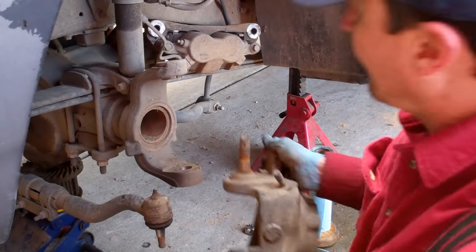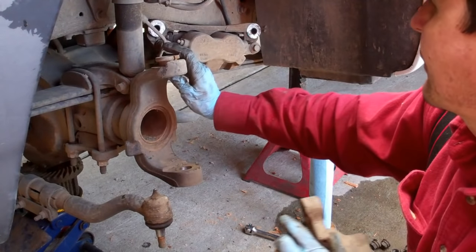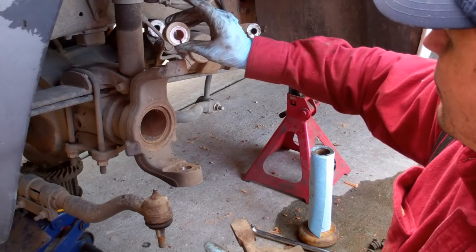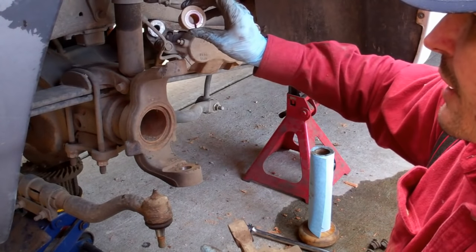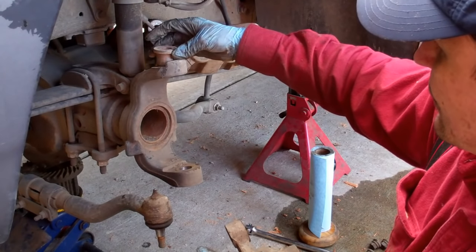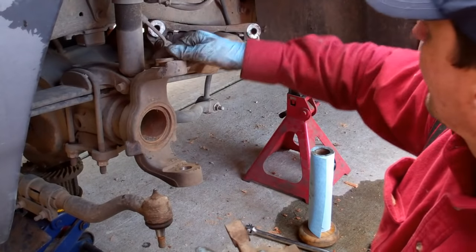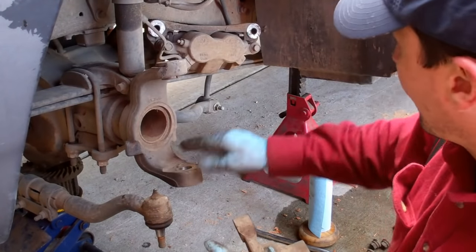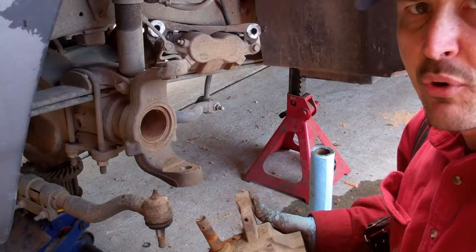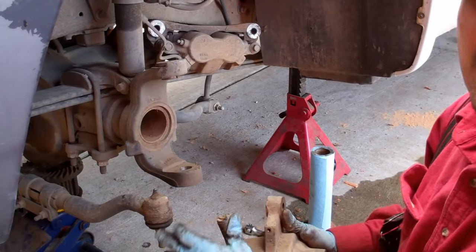All right, there is a little adjuster caster nut, or I don't know what you call it. Mechanics, you guys can put in the description what it is, but it will help with the alignment. We'll have to have this aligned by a professional shop, and I know they can use different sizes of these to adjust your caster or camber. I never remember which it is, but we'll leave that in there for now. So now we have the knuckle off. We'll take this to the vise and press out these bad ball joints, which they definitely are.